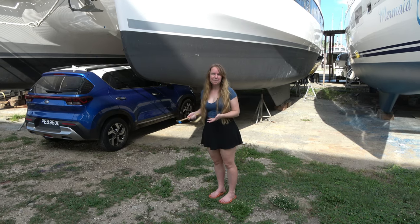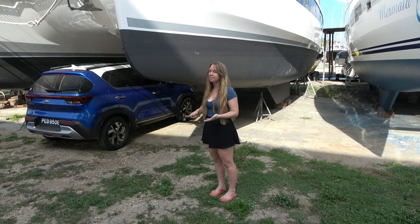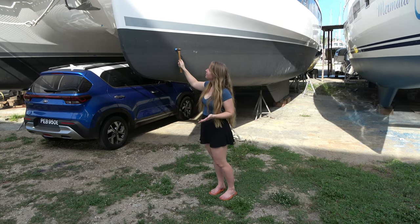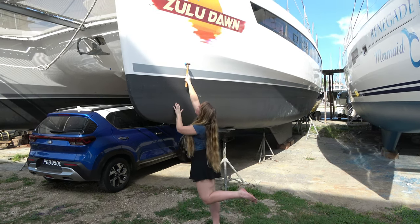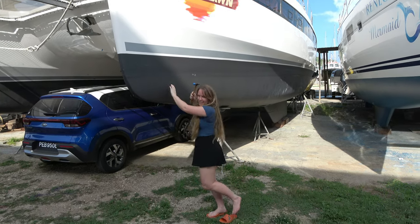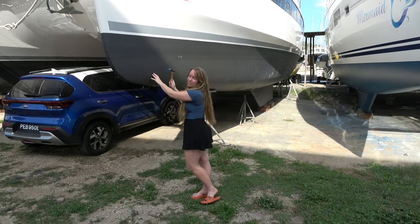To give you an example, this is what healthy fiberglass sounds like on a B3 Series 145 — down here and then up here. The difference in sound is because up here there should be foam core, and down here there's not.